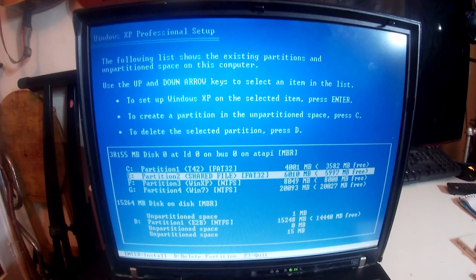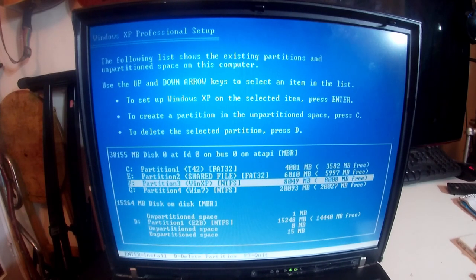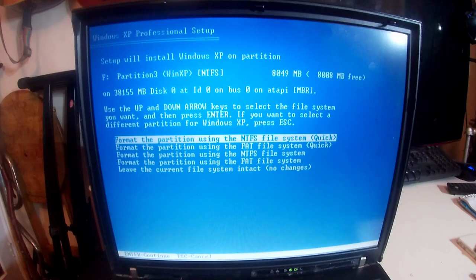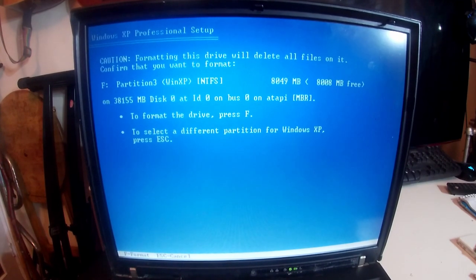As I always say, we're at the bit now where we need to figure it out. So the only difference from the normal one from the video I put in the description is you go down to your Windows XP partition, which I've got as F because it's the third partition. You click enter, then you format using NTFS file system quick. Format, press F.